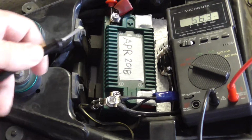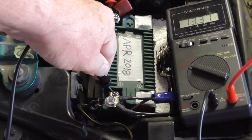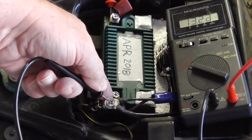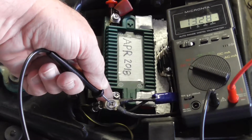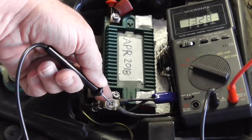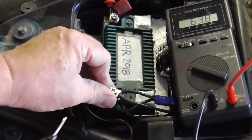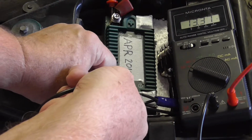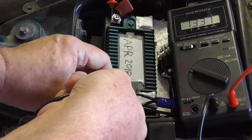First of all, I want to check out a couple of voltages. That's the battery voltage. I've got 13.37, and then voltage to here, got 13.28. So there's already a very slight volt drop across the diode, 0.1 volts roughly. If I move this bolt over and bypass everything by shorting it, I get back to 13.38.